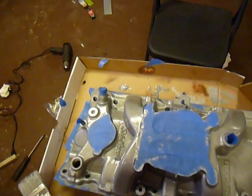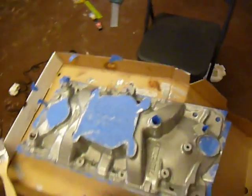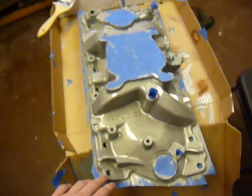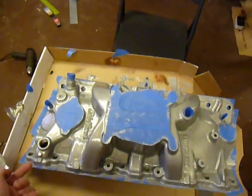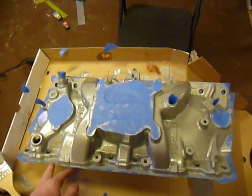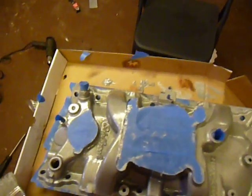This prevents you having to either clean out the holes or re-tap them if it's real bad. This stuff dries really hard, and it can be very difficult to clean out the threads if you do manage to get paint in there. So you want to tape off all your flanges. In particular, the most important ones are definitely the base — both the side runners where it bolts on the head and the two ends where it seats to the block. You want that stuff clean and taped off; you don't want to get the POR on it. If you do, you can cut the edge and scrape it with a razor blade, but it takes forever. And if you didn't tape when you etched the material, you might have etched those surfaces and the paint may stick — then you'd have to sand it off, which would not be fun.